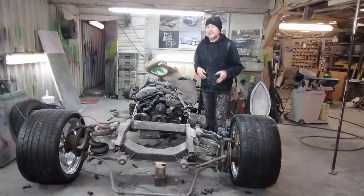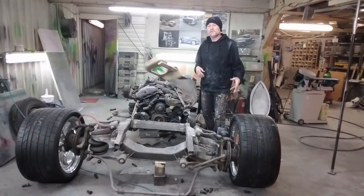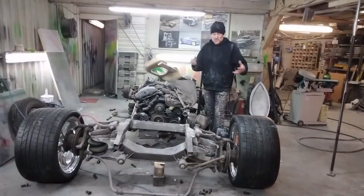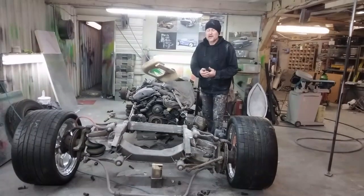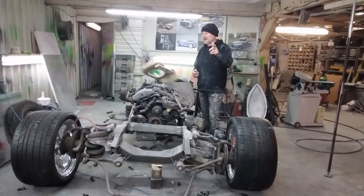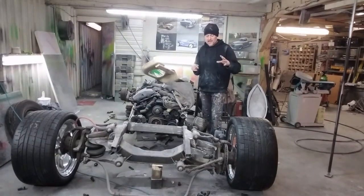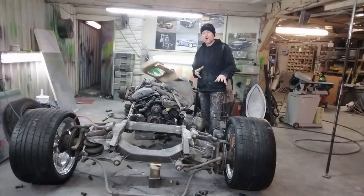All we've got to do now is work out, these are a Jag Chevy stud pattern, and we want to bolt them up to this 6-stud sort of taxi stud pattern, which is the same as you'd have on an Iveco lorry or truck. But Dave Lay's on that, the master machinist, and he's going to make us some adapters so that those wheels bolt onto there.